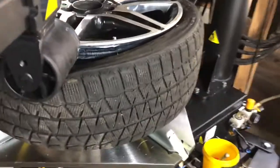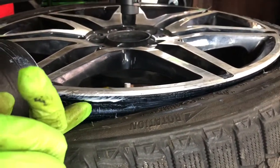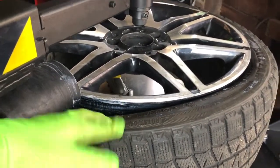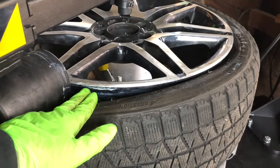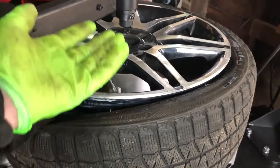So this is what you want to see — you see here is lubrication. I try to get it underneath the edge there, because what happens with these low profiles, friction is your enemy. So you want to make it as slippery as possible and easy to come off as you possibly can. Lubricating right here on the inside will help the tire pop over the rim.